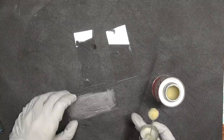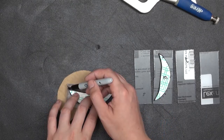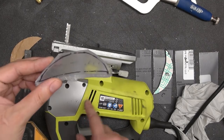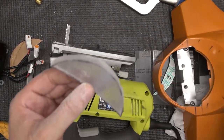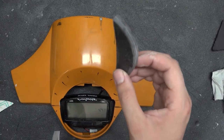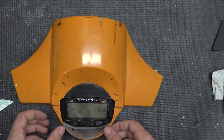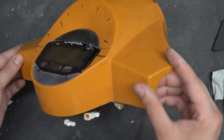In order to get it to 10mm thick, I laminated it with plastic cement. Then I marked out the basic shape and roughly cut it with a table saw. Working with the table saw on plexiglass was a little tricky, but I put the final shape on it on my belt sander and got it to fit nicely. After rounding off the edges and a little back and forth, I got both pieces to just slide right in there. It turned out that laminating four pieces of plexiglass together was perfect — look how nice and flush this whole thing is.